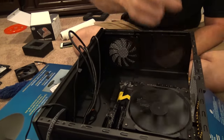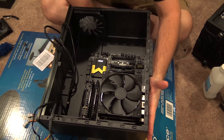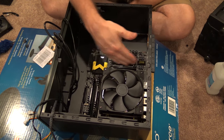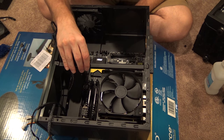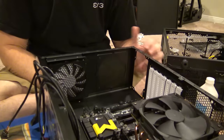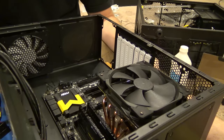So we got two fans blowing in right here directly on the cooler, so that's going to help with cooling. And I think the open vents here with the 80 millimeter fan slots are going to help with some of that heat so it's not going to swirl around in there. We'll have the graphics card right here, so it's going to be semi-compartmentalized. This crossmember support goes right here, and this is also where the hard drive cage is attached. I don't know why I'm so worried about cable management in this thing because it's not going to show, but I care. I've got things wired under the motherboard and fan wires routed in a way that you can't see them.